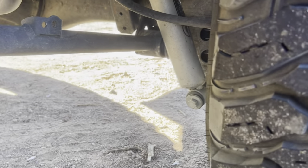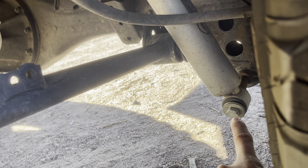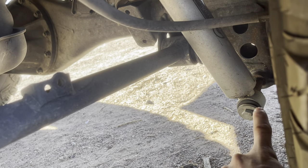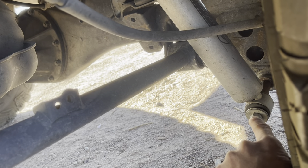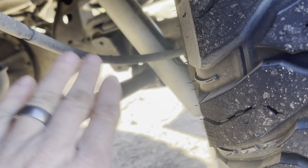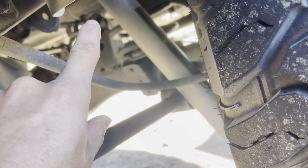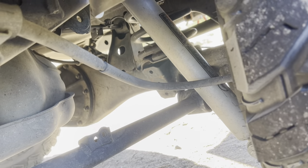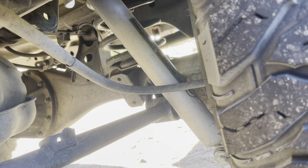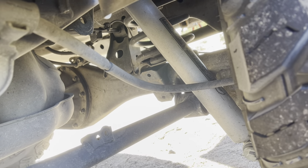It's not an exact bolt-on, so if you copy me you're doing it at your own risk. This was just a temporary setup, but I ended up driving across the country 2,000 miles and then coming back to Arizona, so for the last six months I haven't been able to change anything. It uses a grade-8 bolt that threads into the factory mount, extending the shock out two inches. Overall it has worked extremely well — I lucked out with the valving on this shock in relation to these springs. With the weight of this truck it's a fairly smooth soft ride but not overly soft, and it does well at highway speeds.